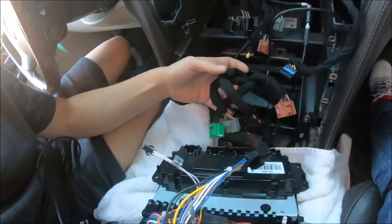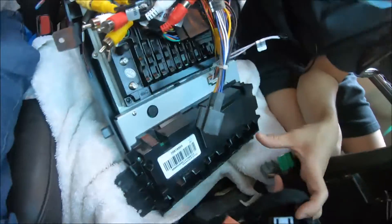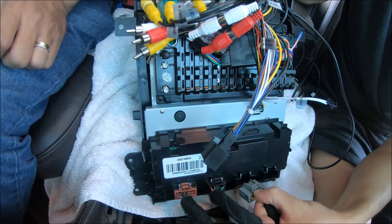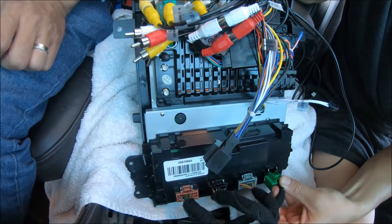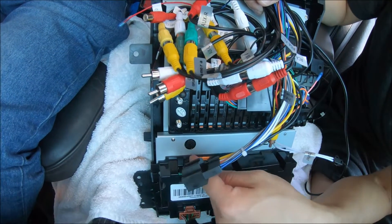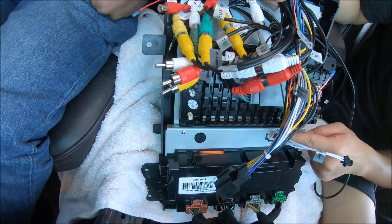Connecting the factory AC panels: we have them labeled as brown, black, gray, and green. We'll go with brown first, then black, gray, then green for the air conditioning. Confirm that the needles and pins are straight if some function is not working. Also confirm that the needles and pins on the two plugs here are straight. Connection secure. CAN bus connection made here.